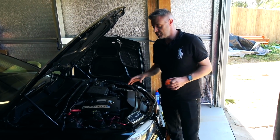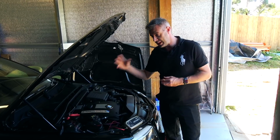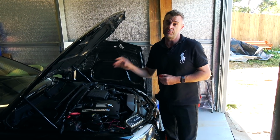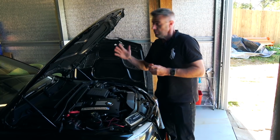So when you're flashing MHD for the first time, the program actually has to go through an unlock process with the ECU. Now traditionally, when I did my car with the cable systems before these dongles came out, it was actually quite a long process. I think my car took nearly 50 minutes to unlock the ECU so you could put your custom tunes on it. It's going to be interesting to see how long it takes with the iOS app.